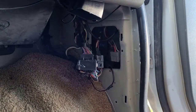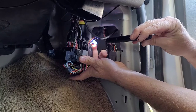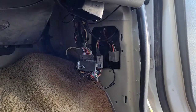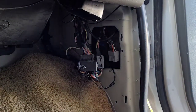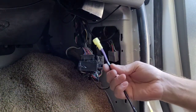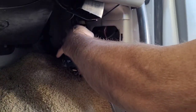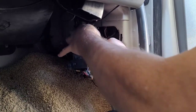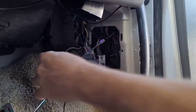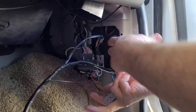In this black plug, black wire with a white stripe, we put a blue T-tap on. Now we're gonna plug the purple with black stripe wire onto this black/white power wire on the blue T-tap. Then we're just gonna plug in the T-harness where we unplugged the gray one.